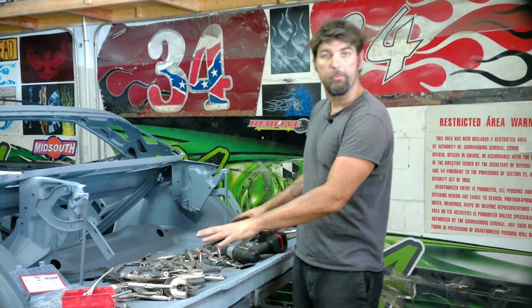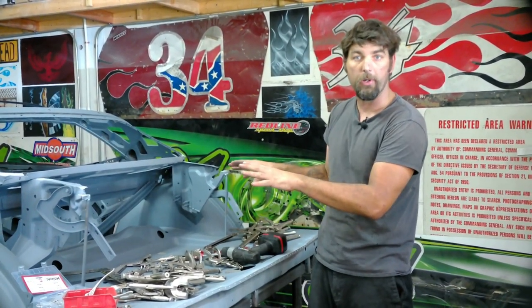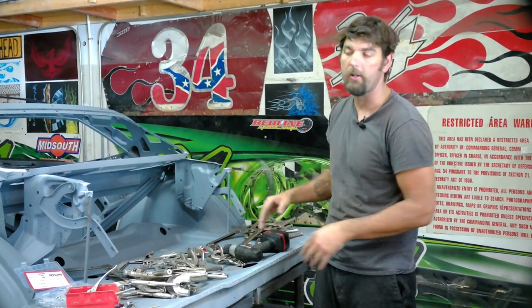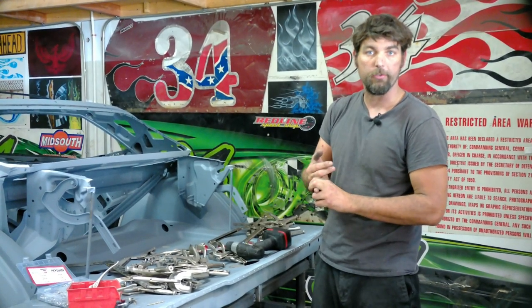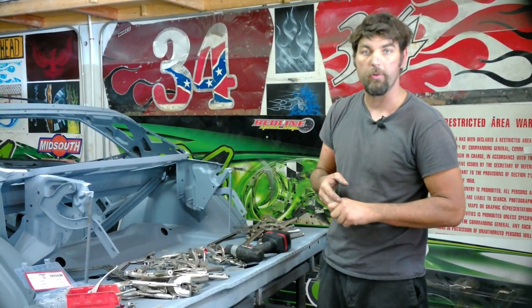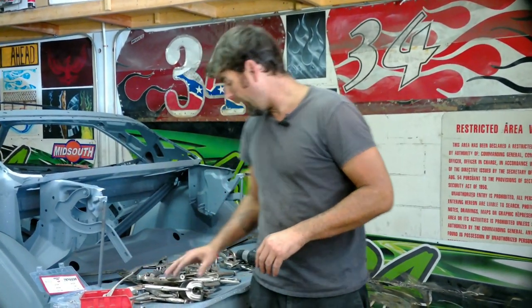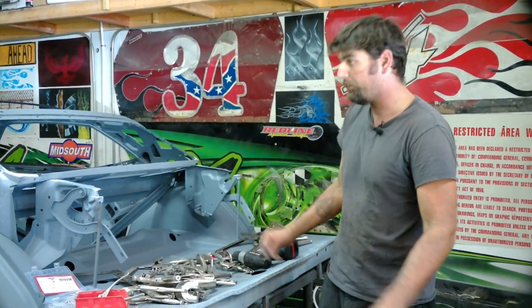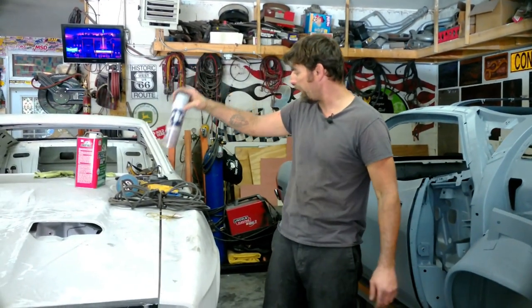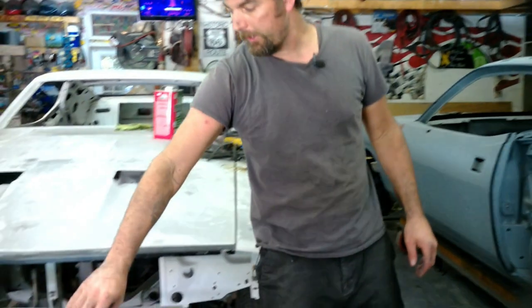I got all my clamps laid out and I pre-staged everything. The panels we're putting on right now have already been on the car, so we'll re-put them on now that they're primed and the spot welds for the rosette welds are already pre-drilled. We're going to use some sheet metal screws, clamps, and lots of vice grips. I put the weld-through primer on and cleaned up the metal under it.